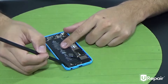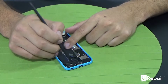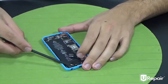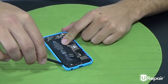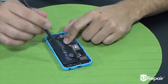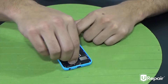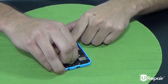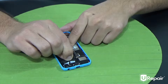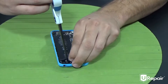The next step involves unfolding a little piece of black tape along the line between the battery and the lightning port. Near the headphone jack, you are going to see the beginning of the tape — pull this upwards and begin unfolding it. For this step, we will be using some scissors to cut this in half. Once you unfold the little tab, you pull it up to reveal two pieces of adhesive, and we're going to cut it right in the middle so we could have each strip of adhesive individually. Let's pull this upwards and cut it right down the middle.